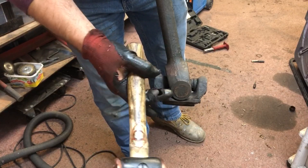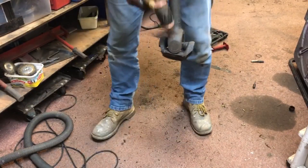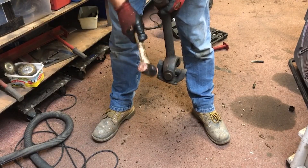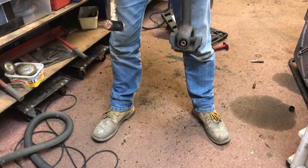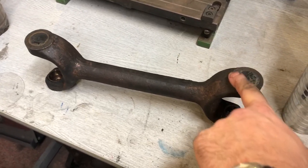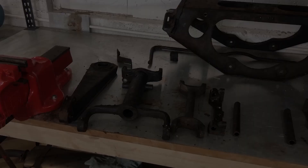After just a few hits you can see that's already proud of the surface. It comes out with a spray of needle bearings. I'll take the needle bearings out but press the cap back in, because if that gets sandblasted it will diminish the tolerances in there.